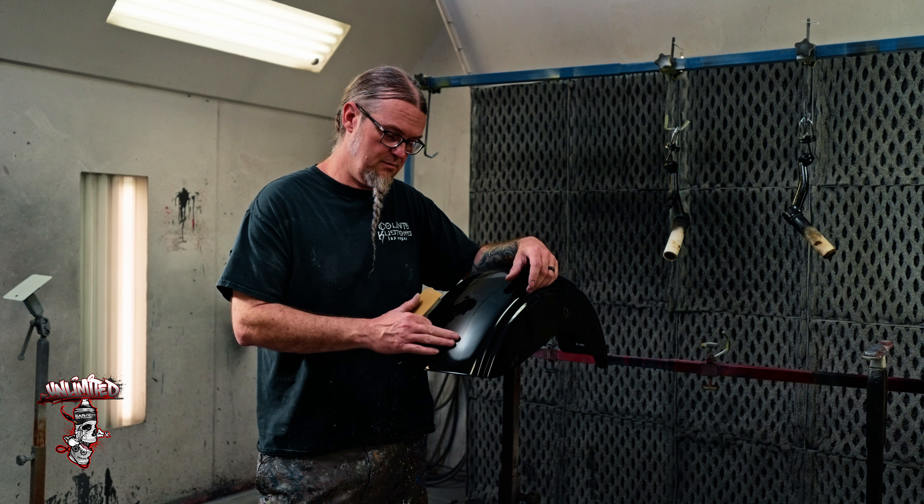I may not talk about a lot of them - I'm just going to motor through these, but by all means watch along, learn, criticize, whatever. In this scenario we are all the way down to the bare metal. Even if we weren't, we still have to feather out the chip, so that's going to bring us down to bare metal anyway. I'm going to feather this out with some dry 400. I prefer to do as much dry sanding as possible, especially when working with raw steel.